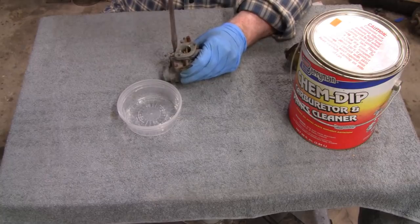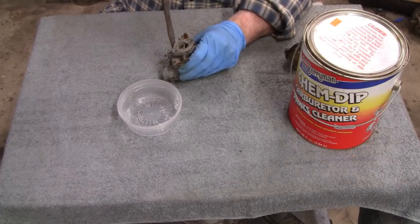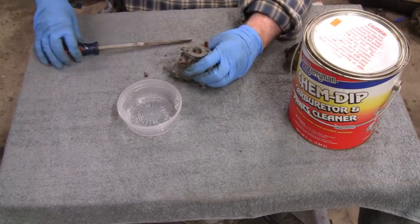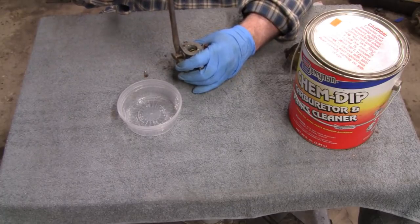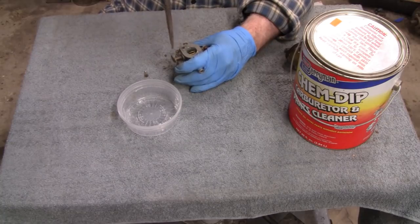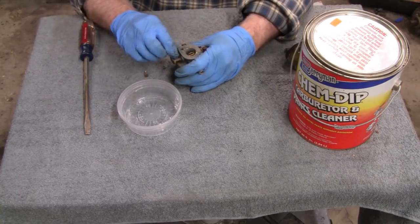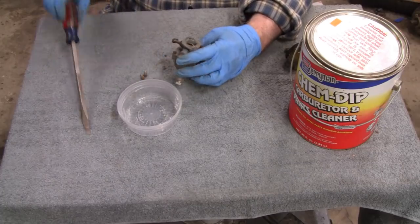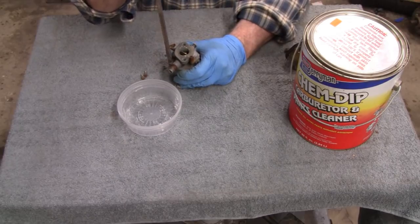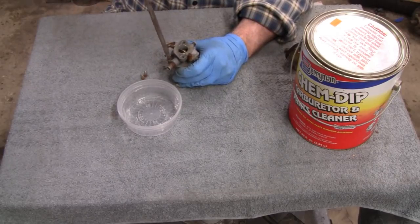Yeah, Mike changed the flywheel. He put the correct flywheel on there and the correct coil. And we're getting a spark, but it was a weak spark. It might have been enough to get that thing started, but we didn't like it. Even with the old cruddy one that they had on there, we're getting a good quarter inch spark. So we didn't like that. He had to go home, so I'll continue working on that.